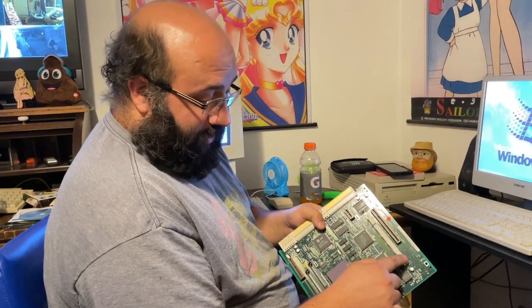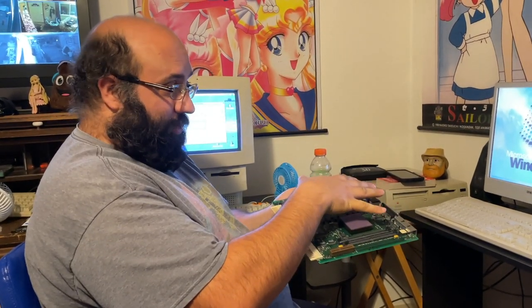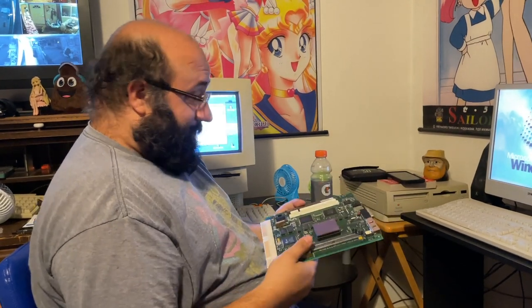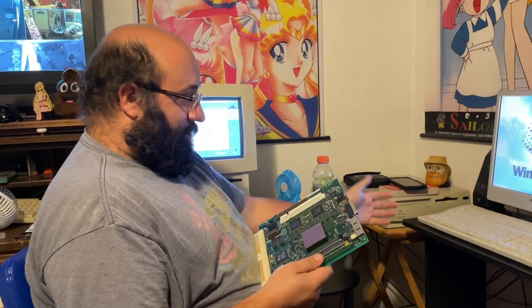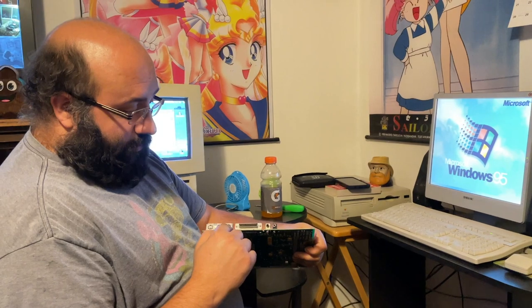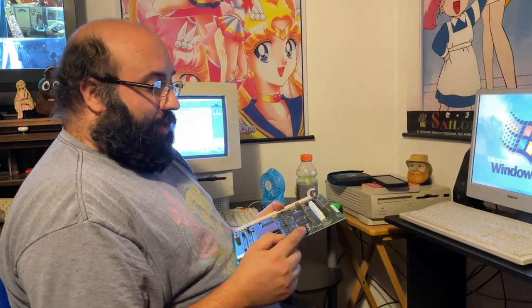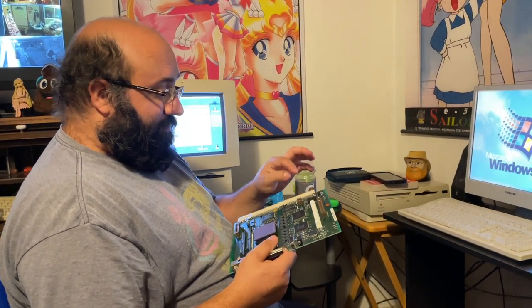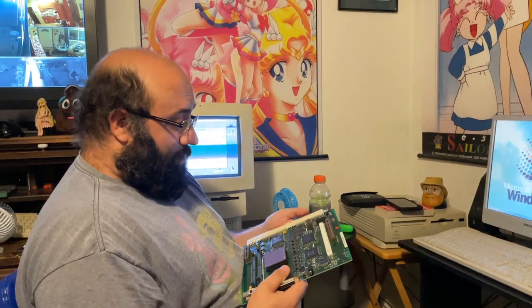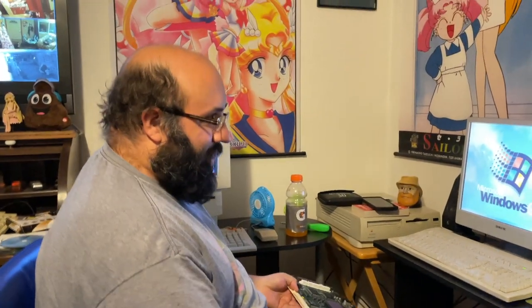That also is hooked to the PC board. So the computer is able to switch between this board, which is the Mac side, and the accessory board, which is the PC side. But the Macintosh part of it has to emulate certain parts of the PC, even though it's actual PC hardware. Your keyboard, mouse, your serial ports — all have to go through the Macintosh software to work with this. Now, sound is done by its own sound chip. The video is done by its own video chip. But any of your inputs and other outputs have to go through this. So it's kind of not ideal.